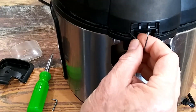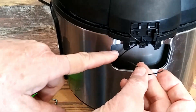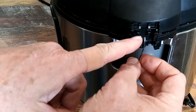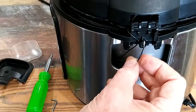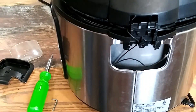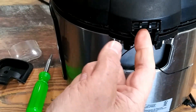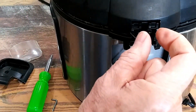There are two tiny wires that go up from the base and the control unit of the slow cooker up into the top for some type of sensor up there. This particular wire, with flexing the lid back and forth so many times, finally broke. The next big issue was figuring out how to get inside to repair it.